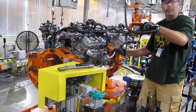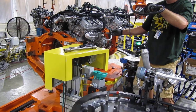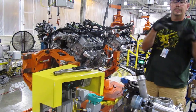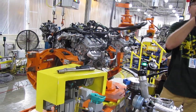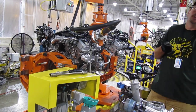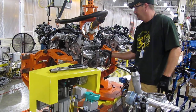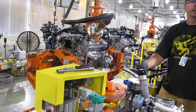The last part of my job is the oil sending line. It's a push-pull. You'll see the ridge on the pipe — there are pegs in there, so when it goes in it'll clamp them and then it won't pull back out. What we do is push it until it snaps, then pull it back to make sure it doesn't come back out, and then push it back to depth. It actually takes quite a bit of effort, but we've gotten pretty good at it.